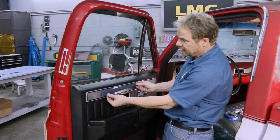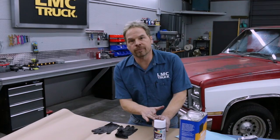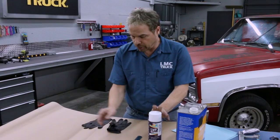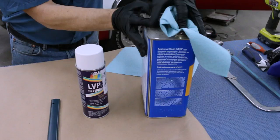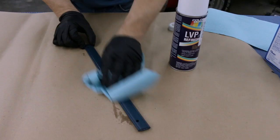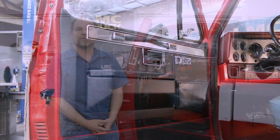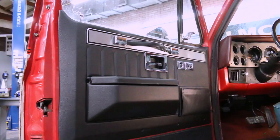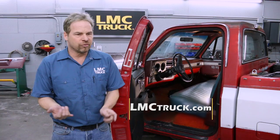The very last step is the door pull, but as you can see, it's in a different color. Don't worry — there's a very simple solution. To color change the door pulls, we're not painting them. We're using ColorBond spray, which actually provides a molecular bond between the spray coating itself and the part. I like to go one step further and make sure the surface is perfectly clean, so I'm going to give it a quick wipe down with acetone to make sure there are no contaminants on the door pull. As with any spray coating, several medium to light coats are much better than a few heavy ones. What an amazing transformation over what we started with, with the crusty worn-out parts that were on this truck. We hope we've passed on some great tips so that you have an easier time restoring or replacing your interior trim panels. You can always go through your LMC Truck catalog or go to lmctruck.com for more ideas, products, accessories, and upgrades to make your truck project even better. I'm Kevin Tates — thanks for watching.